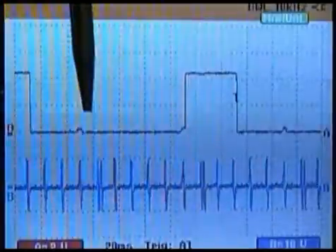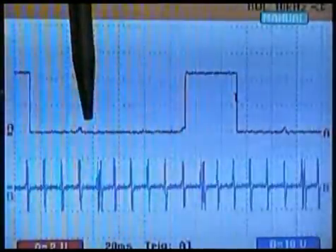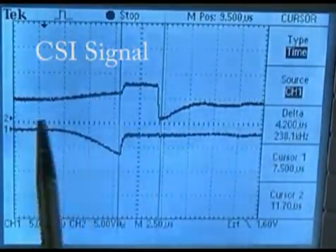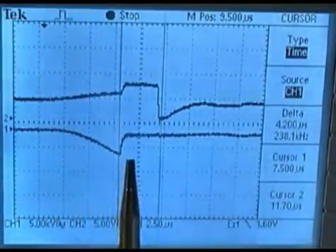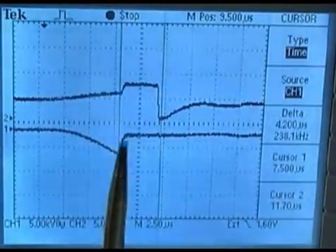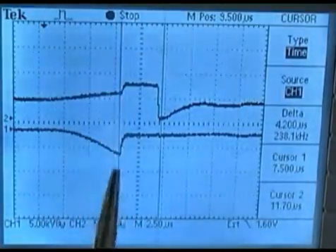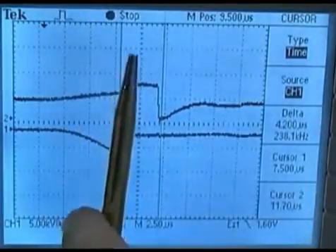This can be caused by the ignition misfiring due to bad plugs, wires, coils, or a bad ignition module. You will notice the CSI signal is ignoring the buildup — a relatively slower buildup of ignition energy at the plug. Because of the resistance in the capacitor, that pass band filter, it is only allowing that positive voltage transition from the break-over edge to be reflected in the CSI signal, from a more negative to a more positive.